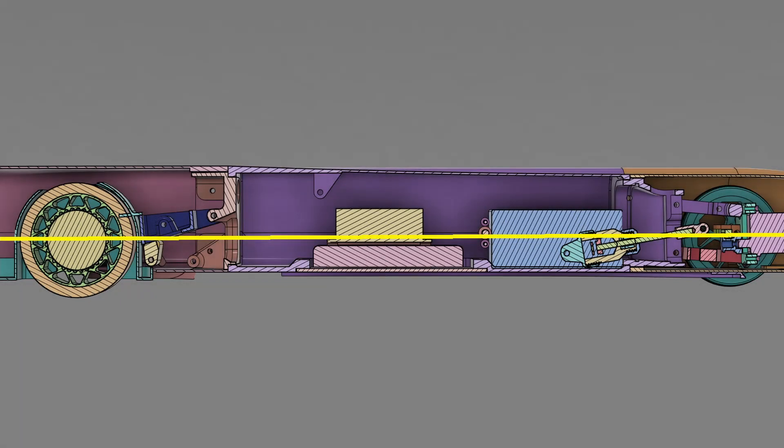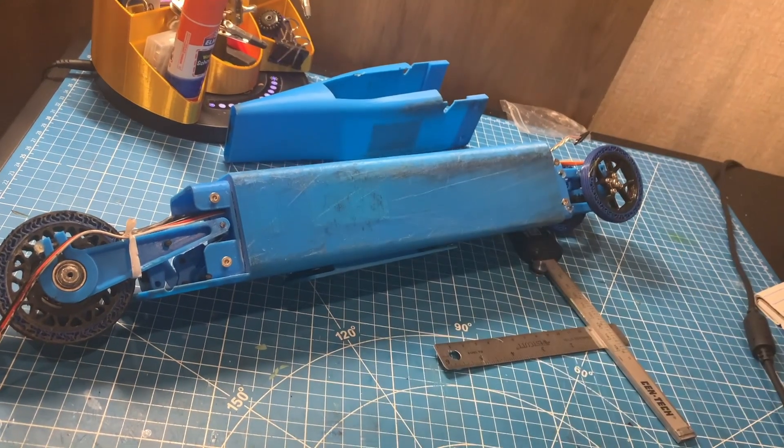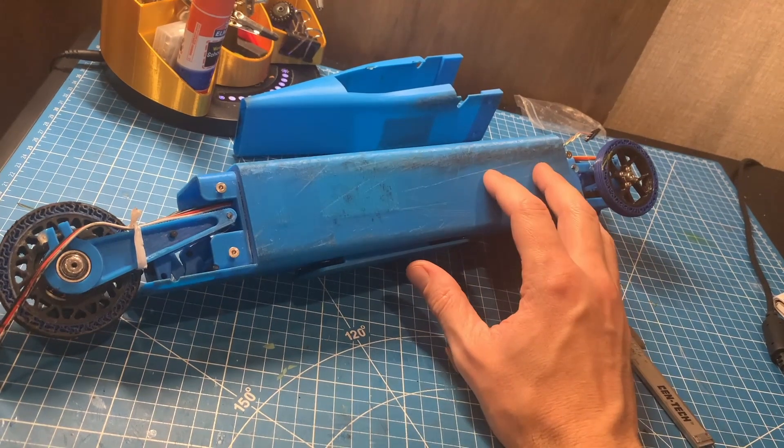That comes down to the location of the mass in the car. Because of the type of non-independent front and rear suspension I have, the roll center will be along an imaginary line between the wheel centers. Roughly two-thirds of the car's weight is the battery pack, electronics, and motor — but at least half the motor's weight, half the battery pack's weight, and part of the electronics weight are actually above the roll center. Because of the necessary ground clearance, I can't really lower the battery or electronics anywhere in the chassis.